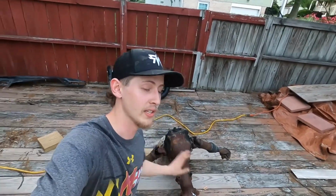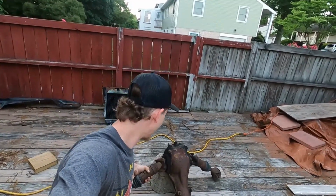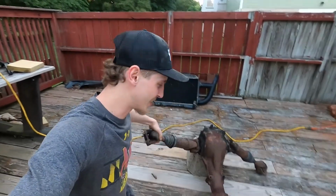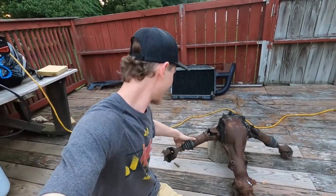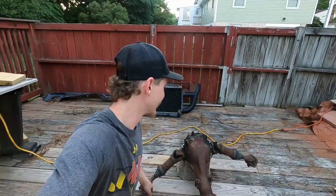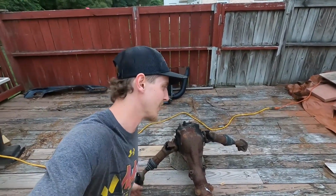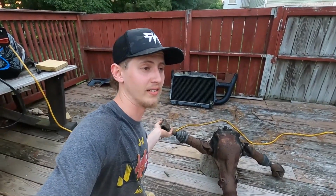All I know is that this thing has drive shaft axles. I don't know if any of the other R200s accept drive shaft axles, but that's definitely got to be a 70s thing. The nuts were all seized on the end of the axles, so I tried to cut it, as you can see, and it's complete solid steel. So heavy. Anybody wants it, let me know. But that is just the weirdest thing. I've never seen drive shaft axles.